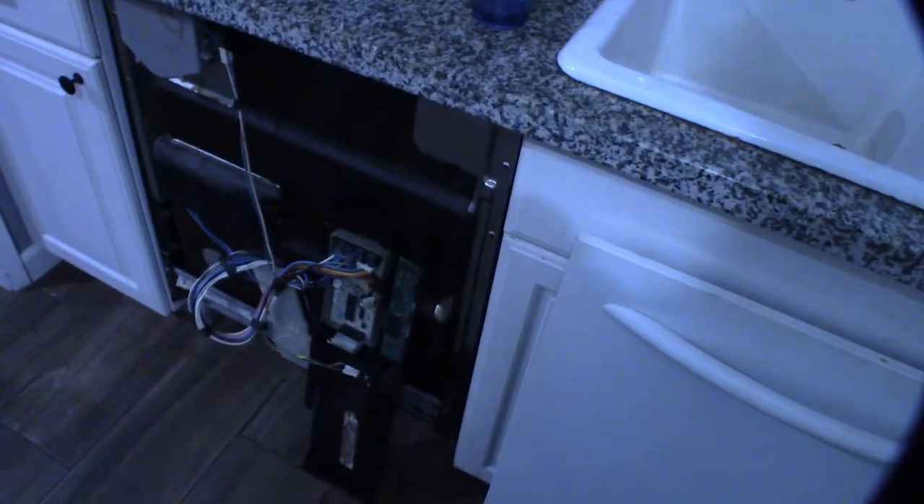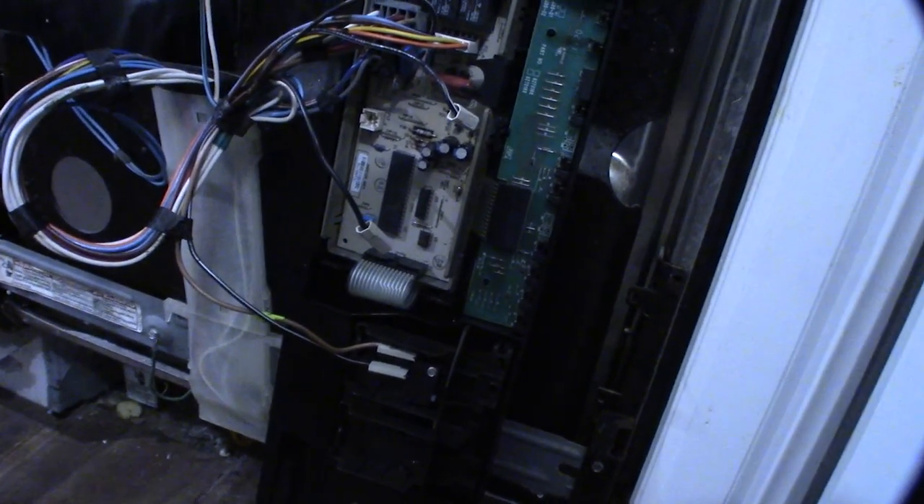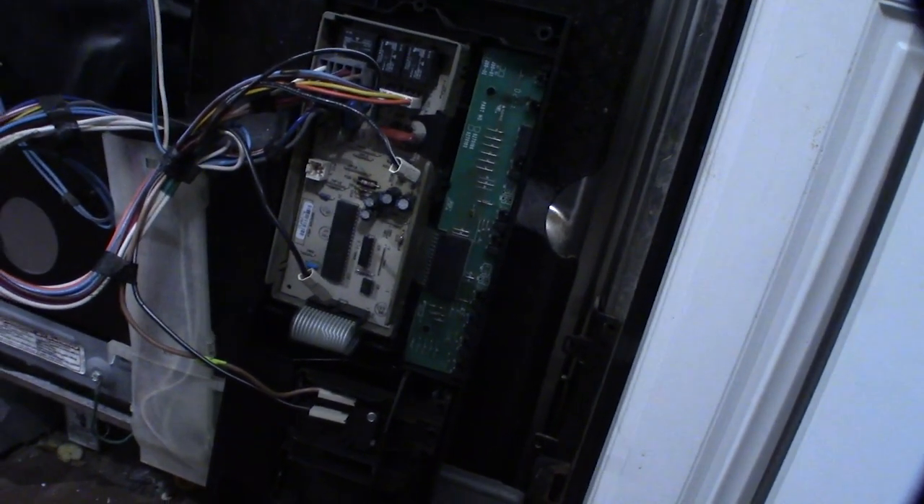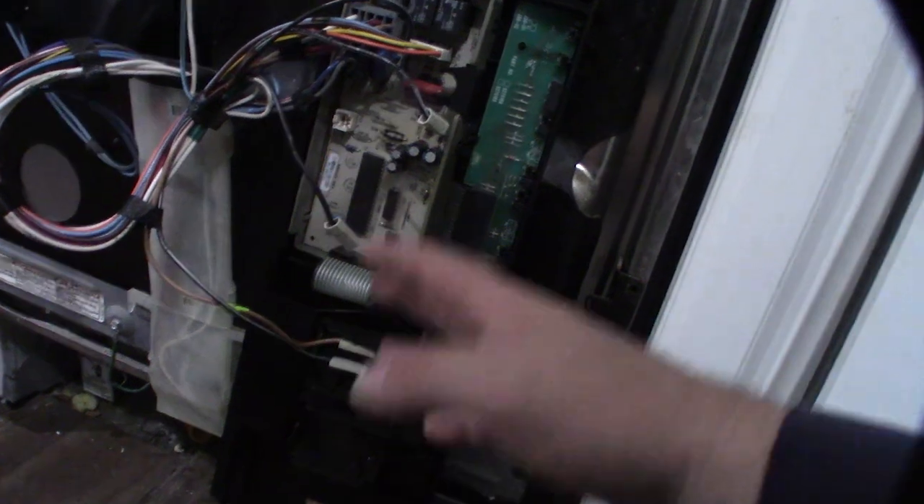You definitely can't go without a thermal fuse — it becomes unsafe. If your motor locks up, what's going to happen is you'll melt your wires and burn the board. You need some kind of thermal fuse protection. This first bracket attempt had the snaps in backwards, so the final version is reversed from that. The wires are still live here — this is what I do for a living so I'm not too stressed about it.